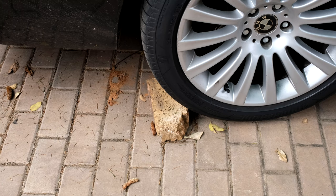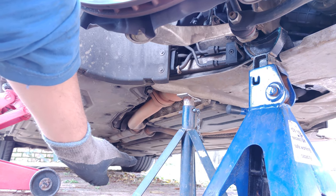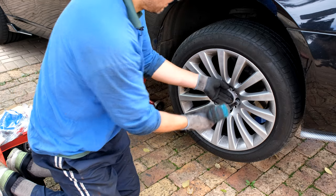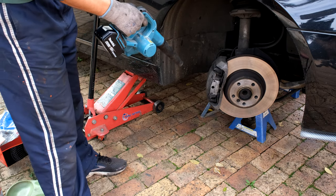Before you do any repairs, remember to chock the back of your wheels so that the car cannot move, the handbrake is on, and it's in park. Please note the use of a trestle and there's another backup trestle just in case. I just blow out the area — I don't want any of that brake dust in my lungs.